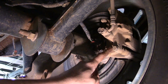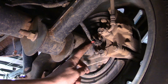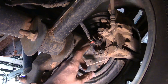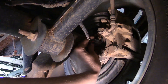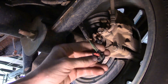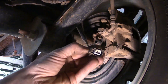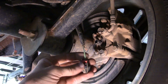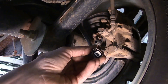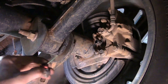This is the left rear of the vehicle — there's your brake caliper so you can get an idea of where the sensor is. The sensor is right behind it with an electrical connector going to it. It's got a two-stage lock — the red piece right here, you need to slide back, and then you can squeeze on the connector to remove it. You may have to clean up some brake cleaner, blow it out, because once dirt gets packed in there the connector won't release because you can't squeeze on the locks.